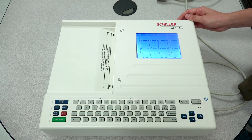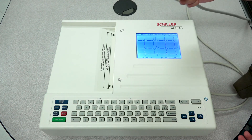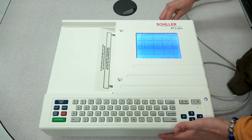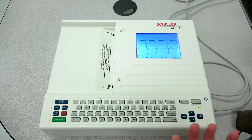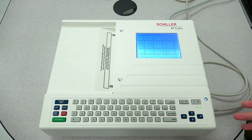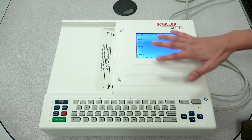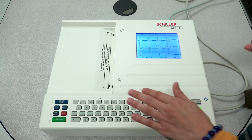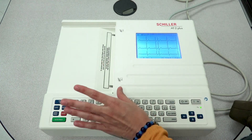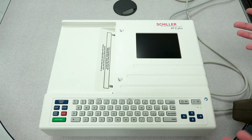This can happen when your unit has not been charged, especially if you don't leave it connected to the outlet. The first thing you want to do if you're experiencing powering down is connect to the power outlet. That will allow your unit to charge, which will then charge the battery and allow your unit to remain on. A common symptom of a power issue is entering all your patient information, having good ECG signal, but the very moment you go to do an auto print, your unit will either print a little or none at all and just automatically turn off.